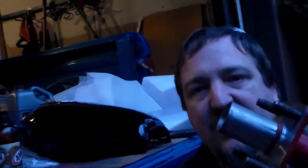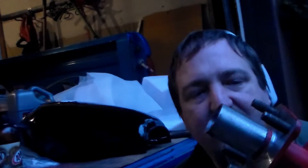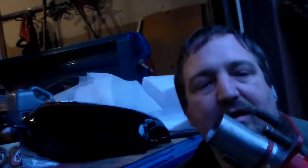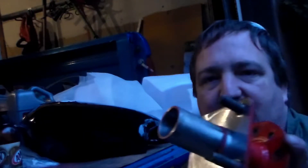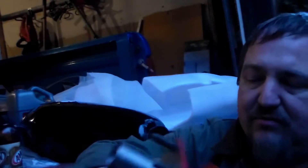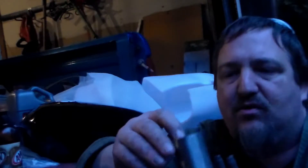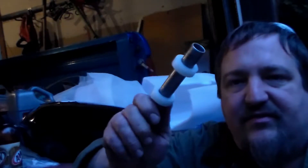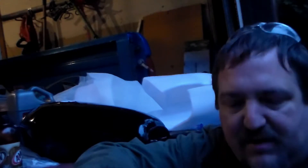I didn't have to take off much — it's still got a pretty damn good hefty weld on it, strong enough for what it is. It's a mini bike, just hauling my fat butt around. We machined the face of it, you can see all nice new machine work. Basically this whole hub has been shortened an inch, the holes were re-bored for the bearings. This had a floating axle on it — if you tightened the nuts down, it crimped the bearings and the wheel wouldn't spin.